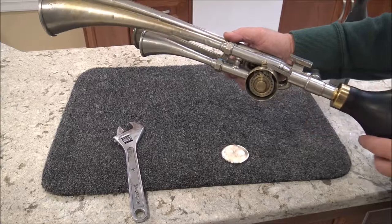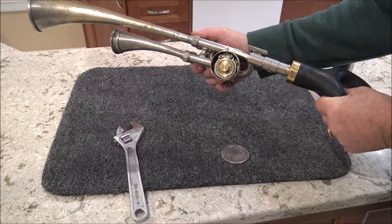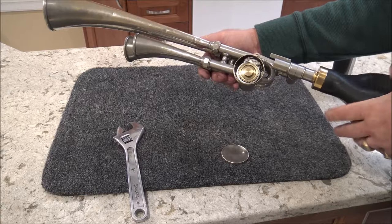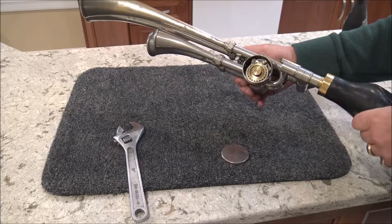You can see there's a small arm here, currently in the forward position. When you depress the horn bulb, it advances the arm, and as you retract or release the horn bulb, it retracts back on the cylinder cogs. As it rotates, the cylinder — due to the slots on the inside — directs air to a different horn.